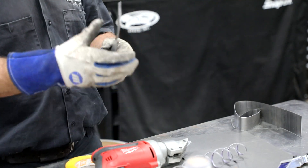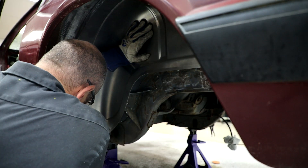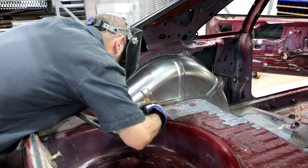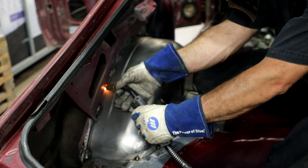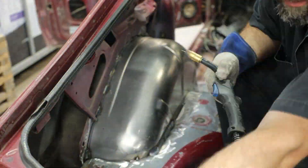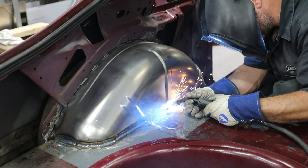Save this strip of metal to be used later for the upper shock closeout. Position the mini tub back into the vehicle and clamp it in place. Make sure the edge of the mini tub overlaps and fits into the factory step in the outer wheel well; otherwise you will have a gap at the top of the mini tub. Begin tack welding the mini tub in place in multiple spots along the trunk floor from inside the vehicle, then stitch weld around the top arc of the mini tub. Tack weld the flange at the front corner to the mini tub, hammer the flange to fit tight against the mini tub and stitch weld. Finish weld the mini tub to the trunk floor from inside the vehicle. Stitch weld the mini tub to the outer wheel tub along the seam.